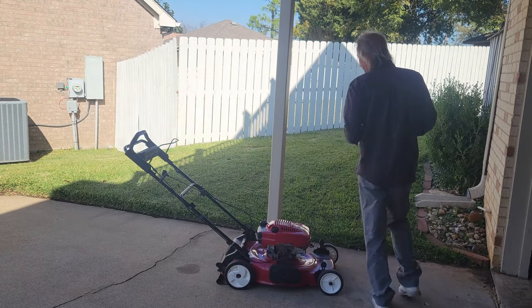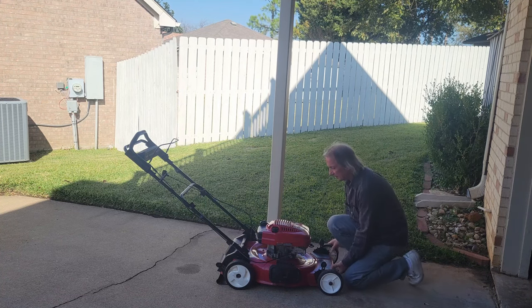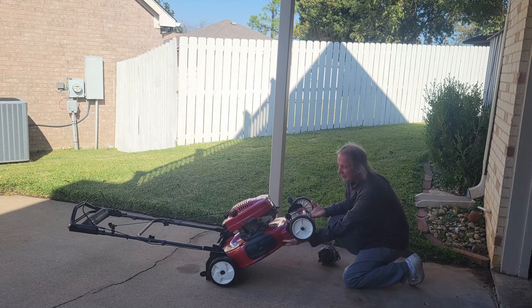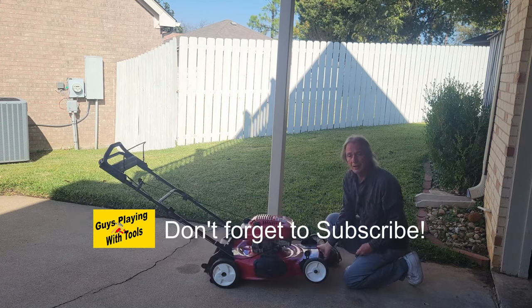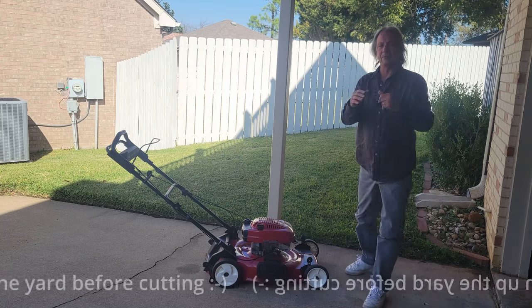The first thing that can happen is you can have something caught in the blade. You may roll the engine up and look underneath it — grab the blade, and now the blade turns. If that blade turns and you've cleared the obstruction underneath it, go ahead and give it a try. You might start right up and be fine.